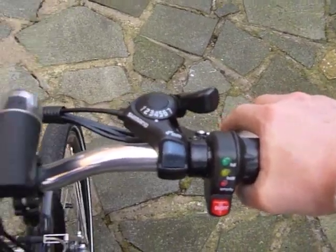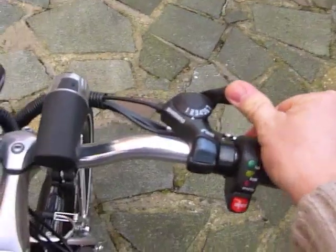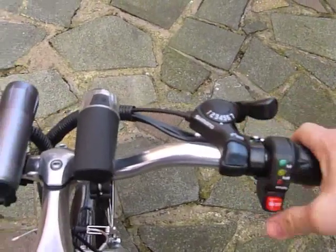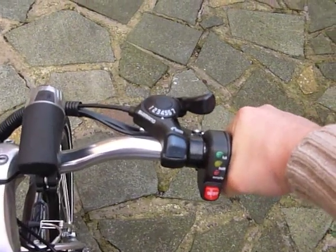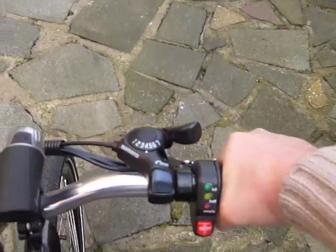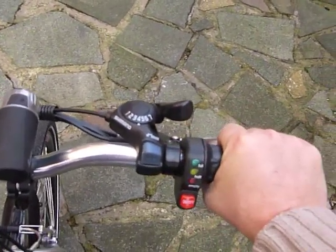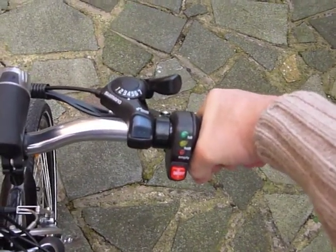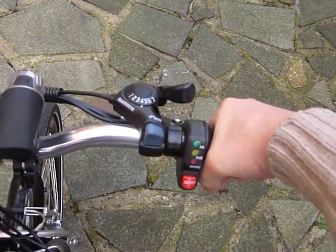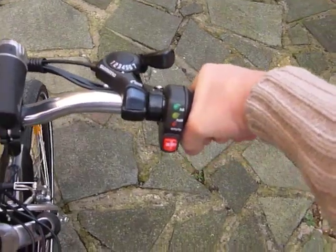The other thing I've realised is when you're going up a hill, depending on the severity, put it in second or third. The lower your gear, the better the electric power seems to work. If you're going along in fourth and start to go up a slight incline, train down to third or second and you'll get better traction from the electric motor. If you leave it in fourth or higher, you'll really be struggling to get up that hill. So that's my top tip for the day.